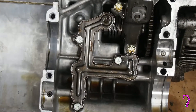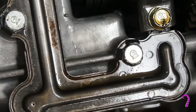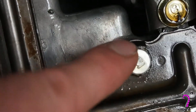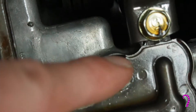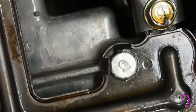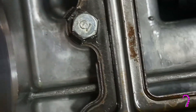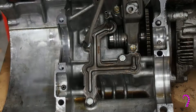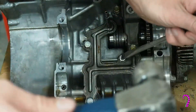Next we need to remove the oil passageway pipe. This is actually an interesting one — if you ever really want to be sure whether someone's taken your engine apart, check out these little tabs. They have a coating, painted along with the rest of this part, and in order to get this part off you need to bend those back. So if this part has been removed before, the paint's going to be chipped. Interestingly, it looks like these are original — at least they haven't been removed before, all the paint's intact, except for this tab which I just removed. I'll use a screwdriver and a small hammer with a light touch. You can use a pick, but these things are tougher than they look and it's a really good way to spear your finger.